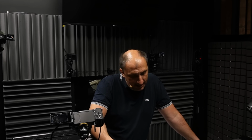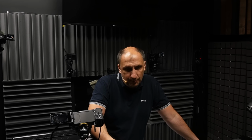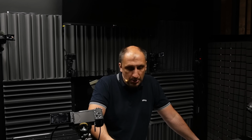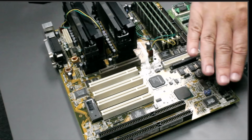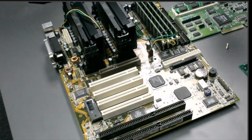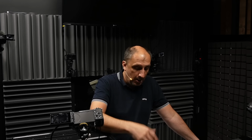because at times these motherboards, especially for the Pentium 1 to 3 generations, if you were assembling your computers manually, which is what I did, were a little bit buggy in terms of BIOS settings and whatnot. They required you to read the manual, no question, because the configuration of, for example, these jumpers that we used to have determined whether or not the AGP slot is going to work, whether or not the CPU is going to work, the multiplier, the FSB frequency, whatnot.